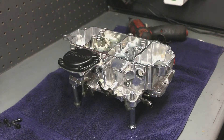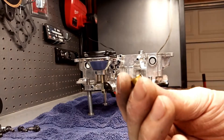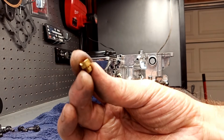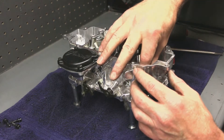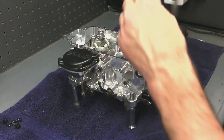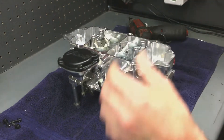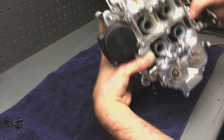So jets are down at the bottom of the bowls — pretty easy to get to. The jet reads 68. I'll put that back in. So you can access all 4 jets that way, pretty easy to get to. One of the things I like about these over a standard Holley is when you pop the float bowl off — on a Holley it makes for a nice shiny aluminum intake and you get fuel all over it. So all 4 jets are right there, easy to get to.